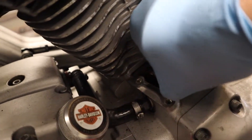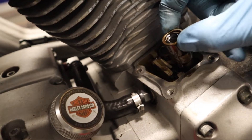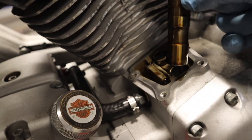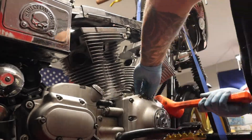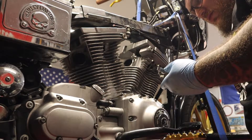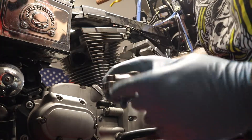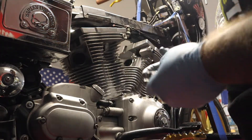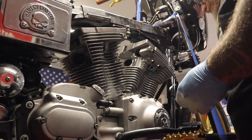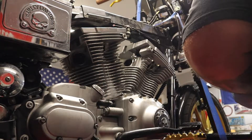Now the lifters are engorged in oil — as you can see it's all spilling out — so you may want to wrap these in a paper towel or something. I used a dead blow and it didn't do any damage; just getting it off. And then of course the gasket — obviously not reusable, that goes in the trash.